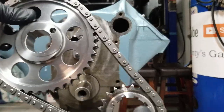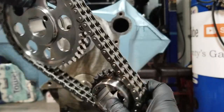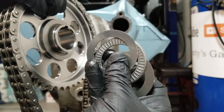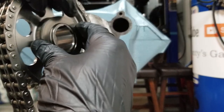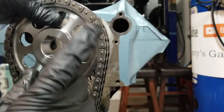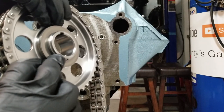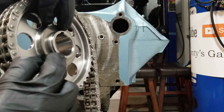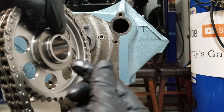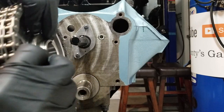It's time to put our timing set on. This is a Roll Master timing set with that matching bearing on the back — again from Sims Precision Machining; I'll leave a link below. Butler Performance actually makes a very similar one with a Torrington bearing, which has ball bearings but is loaded for thrust loading in both directions, so you don't need that plate. I think it's a lower-cost alternative.